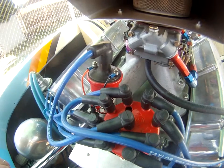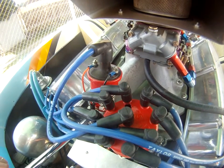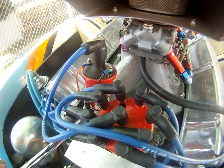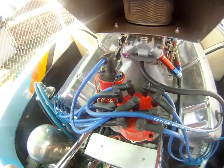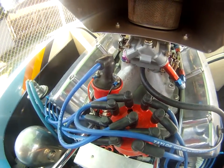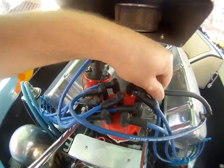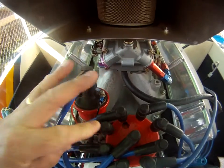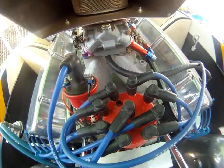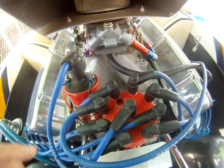30 degrees is where you're going to set it dead on center, and then once you put everything together and check it at 36, it's going to be sitting slightly to the left. So this is probably ready to go. What I did was move this wire — it used to go across here — I just loosened it off the loom so I can move it out of the way to check it with the timing light. That's the number one cylinder at 36 degrees before top dead center.